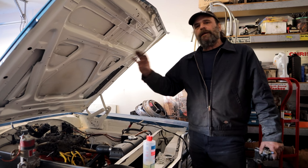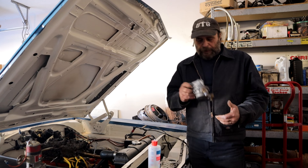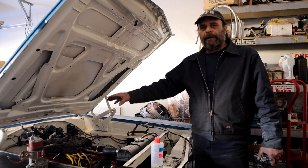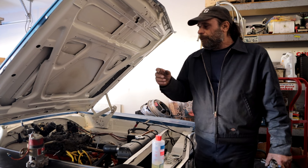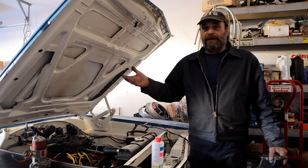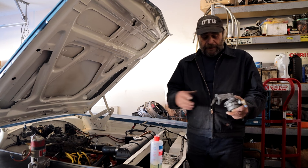When we put it together, I wanted it to be period, simple, and I wanted to use a mechanical fuel pump. Right away from the very first time we lit this thing, we had fuel percolation issues, because during the period of time I was gone from street cars, gasoline changed and the characteristics of gasoline changed. I learned it the hard way with this.